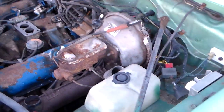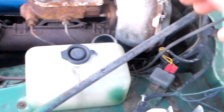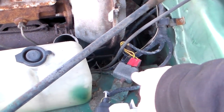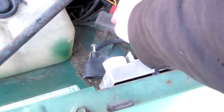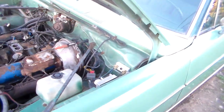Here's something to note on this car. This is a 74 and it has the infamous starter interlock for the seat belts, which has been disconnected. But there's also an emergency start switch relay on it — in case that system ever acted up, you could come out here and trip that thing and it would let you start it one time. But that's not the issue here because it starts fine with the key.